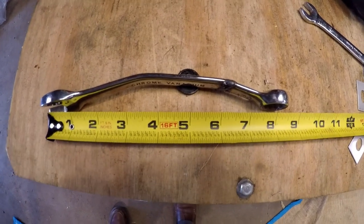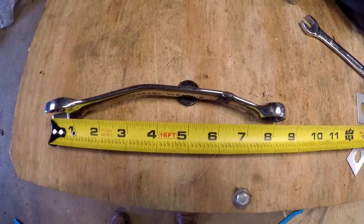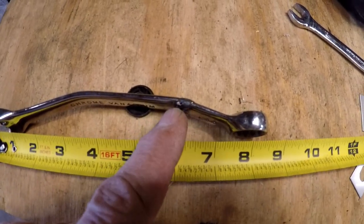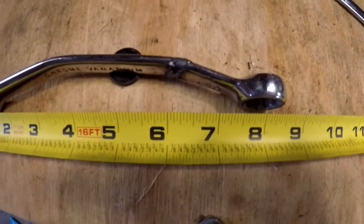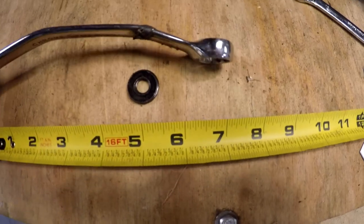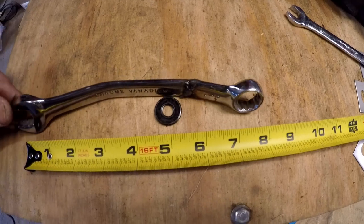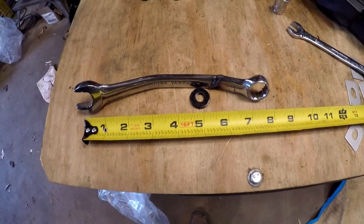Here's a little detail about what I did for this wrench — you could possibly do this with an offset 18mm, but I just didn't have that. I basically cut it here and re-welded it at a little bit of an angle. You can see the measurements there, and I was able to stick that into my frame and hold the bolt. Not the best weld, but you do what you have. That's 18mm, and that's what you're going to need for your frame bolts and your bottom bolts.